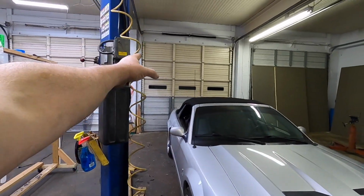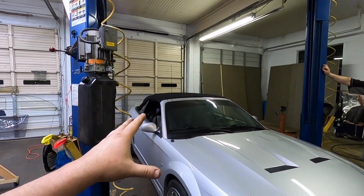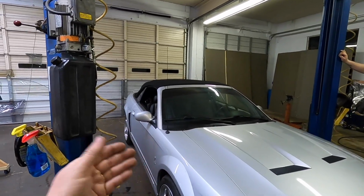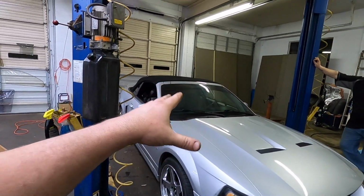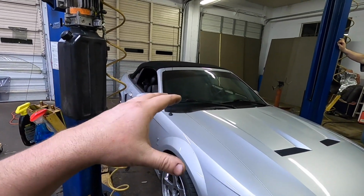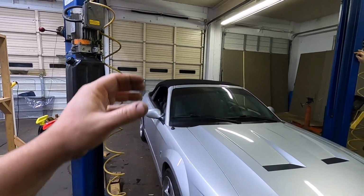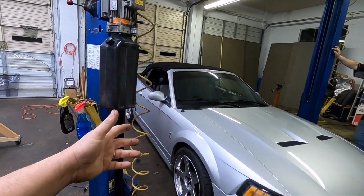However, it's been storming outside and it's raining right now, so I'm gonna wait till I drive it down the road in the morning. Remember, we cannot get on it. A brand new clutch needs about 500 in-town miles before you get on it pretty strong. We will drive it enough to make sure everything's acting correctly and that we have the clutch adjusted properly. Go through a few gears and things like that. So guys, we will catch you in the morning.